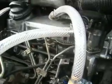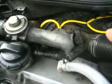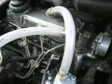So I had to cut in some larger nipple sizes and use larger tubing, and that did a great job. I've actually moved all of the coarse steel wool up into this area. So now the air comes in from here, comes in this tube, goes in here, gets separated. There's a drain at the bottom and an indicator in the back to show how much oil is in the container. Then from the top, the clean air — the oil-separated air — goes back into the intake, and hopefully that'll help keep the intake clean.